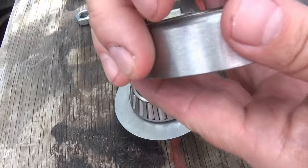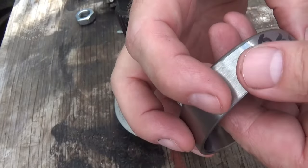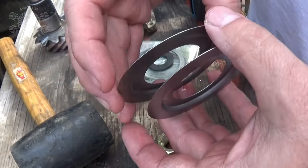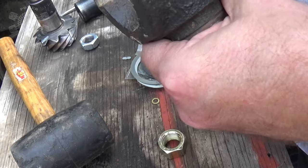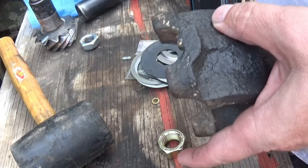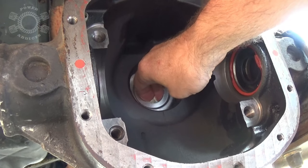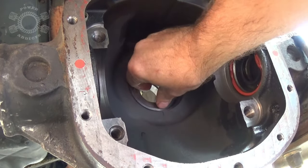And also we have our setup race. This is the one that I put on the belt sander, holding it like this and just going around like this - shaved it down to reduce the overall diameter so it goes in and out of the differential really easy. Why? Because we're going to be taking shims, adding and subtracting until we get the proper pinion preload that we need. The kit came with two of these. Now originally when I took the diff apart there was only one of them, so we're just going to go with that and add the shims. There's my yoke right here - seal surface looks pretty good, it's not grooved or anything like that, so I should be good to go.